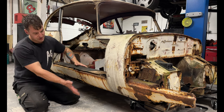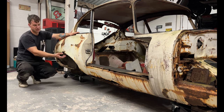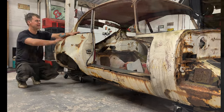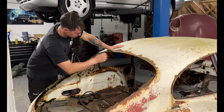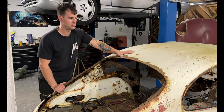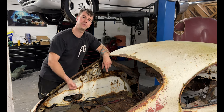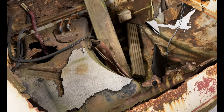It's a lot worse than I thought - I'm going to have to skin the outside and possibly the inside as well. The rear quarters will have a lot cut out to make way for the body kit, so the holes there don't really matter. All the inner arches and workings underneath will be going, so I just need the rear quarters and the roof from this side. The rear bracing has rotted away too, so I'll need to add structure. I'm also unsure whether to skin the boot and do a smaller flip-in-and-out boot lid, as I'm not a big fan of the sideways flip on these.